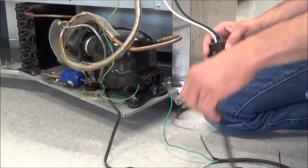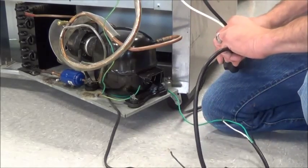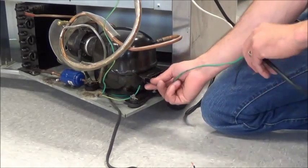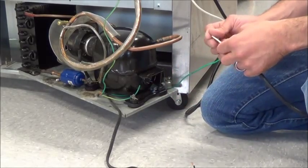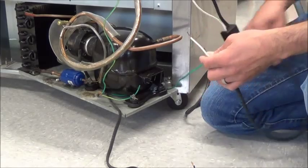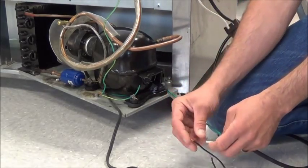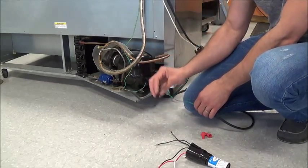This is where the thermostat sends 115 volts to the compressor to turn it on. We want to follow the power cable from that terminal block — it'll usually be plugged in like this — over to the compressor. I already removed the start components, which is the relay, the start capacitor, and the overload. What I want to do now is take this 120 and tie it into my hard start kit, which is my 3-in-1, and the power wires to the condenser.